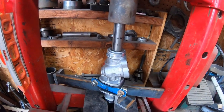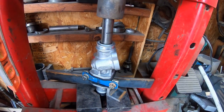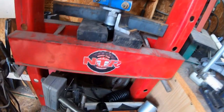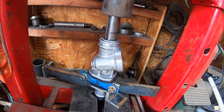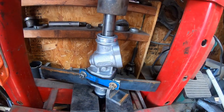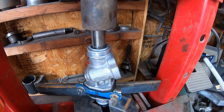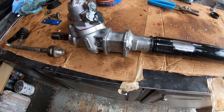I found a way to get rid of the seal inside this rack. I found a piece of tube that was the right outside diameter. Tried to beat it out with a hammer but it wasn't easy, so I tried pushing it out the bottom with a press. A lot of resistance but it's pushing on that seal. I'm running out of stroke on my jack. All right, I got it all back together — that was a pain in the butt.